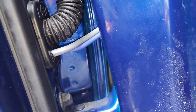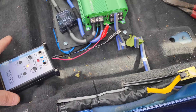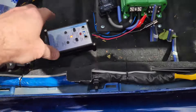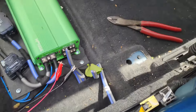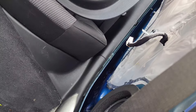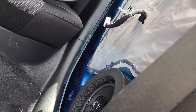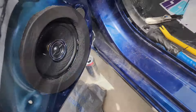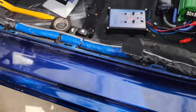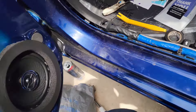There's a quick shot of what it looks like when it's done. Now that I've got my wires running on my left side of the car — front and back — I'm going to go ahead and do a tone test to make sure the wires are connected good. Rear left — alright. Front left — good. Now you can probably put your trim stuff back on because you know your speakers are working.